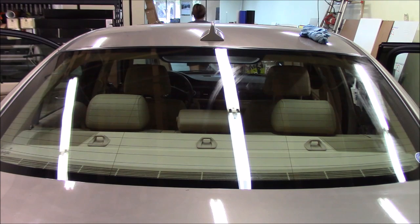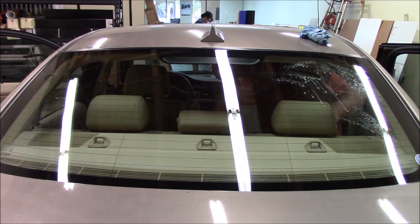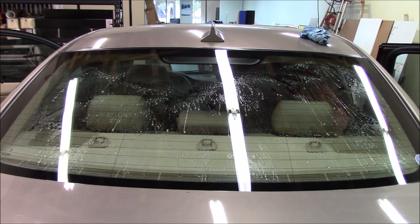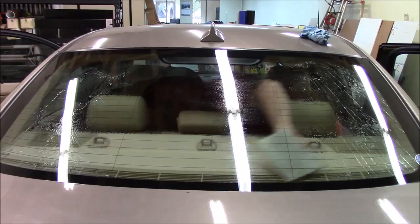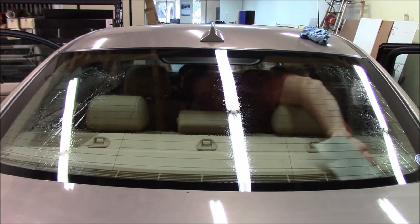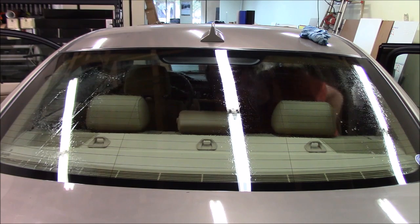Okay, so I'll go inside and I'll show you how to clean the inside. Just want to use some mounting solution just like we do for everything else. Just spray it on there real good. Okay, and then remember we said that we're going to use a white scrubby instead of a blade to clean this, and we just go in and start cleaning. Just put some pressure on it, and you'll feel if there's anything on there as you're coming across. Just get one section at a time, like that. I can already see a bug fell out of there, a little dead ladybug. Okay.